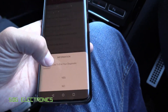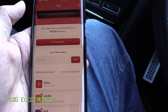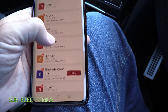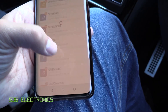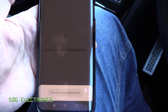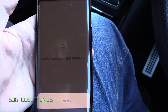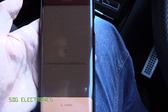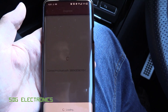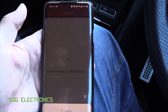Where this app has enhanced functionality is in the All Systems Diagnostic section. This is the part you pay for if you want future updates after the first year runs out. Selecting Ford, a couple of beeps as it connects to the device, and then we've got significantly more advanced features. It communicates with every module in your car, works out what's installed and what's not, and reads and talks to all of them through the software — it's actually quite fully featured.